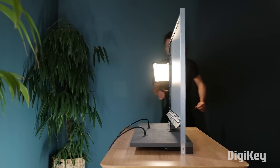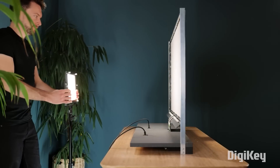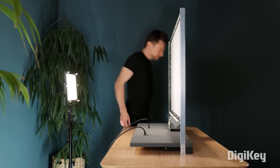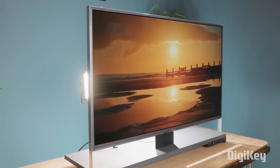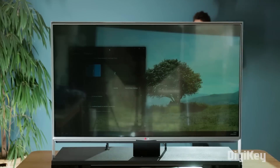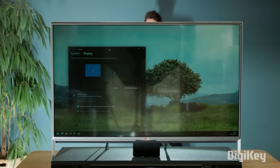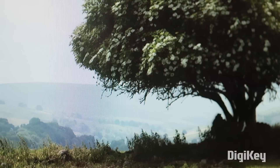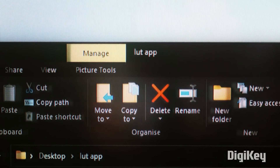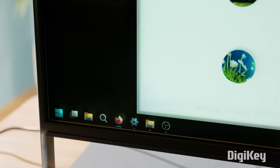To create this new high contrast television, he's taking the LCD panel from a salvaged television, removing the backlights in the back, and then combining it with a completely separate display — a projector. By aiming a projector at the back of the screen, he's able to achieve a higher resolution of dynamic backlighting for the LCD. It's tricky to align, and there's certainly some issues with ghosting, but it's beginning to look like this project might actually work.